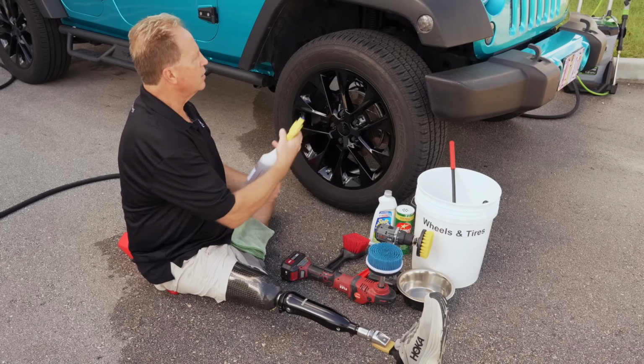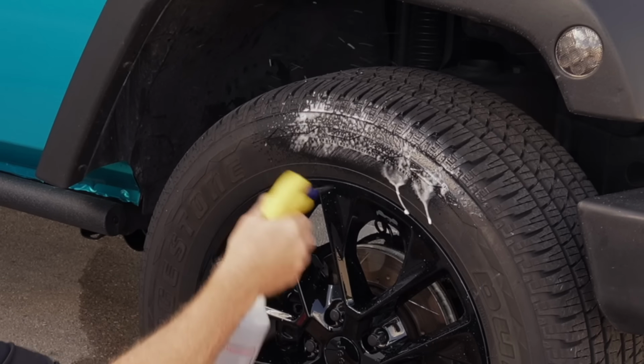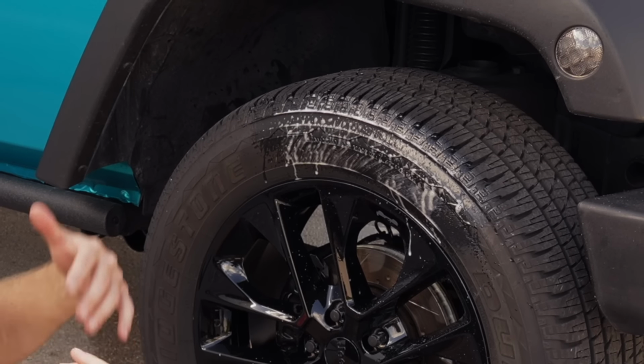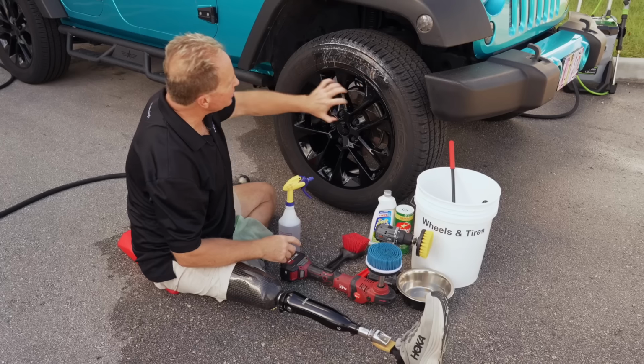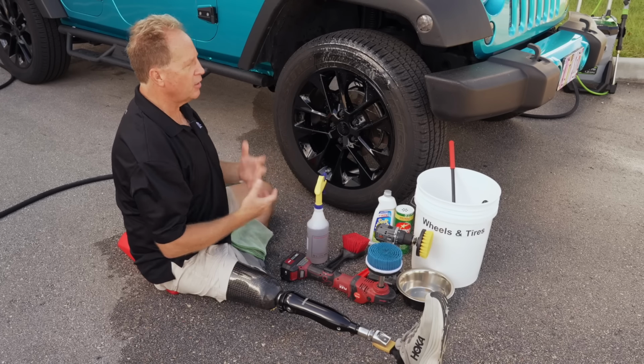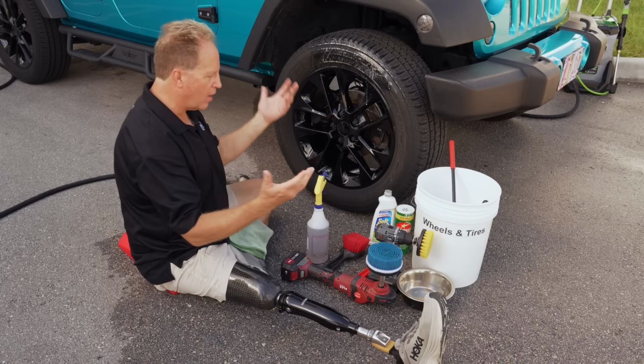This is our new tire cleanser. It's a foaming tire cleaner, but when you look at this, well, a little bit of foam comes out, but the idea is this is not a foaming sprayer. It doesn't come out foamy. The idea is when it's agitated with water, that's when it creates the foam. And when you first start out, you'll usually see kind of a brown foam, and you want to scrub 2 or 3 times until you see nothing but white foam.